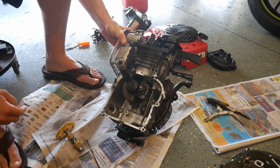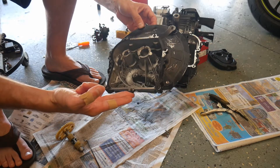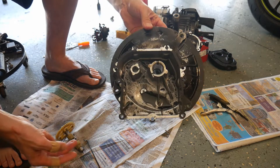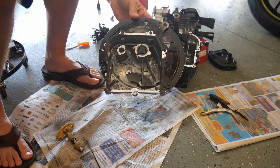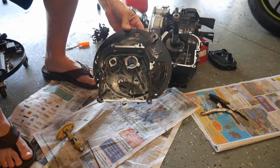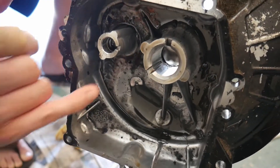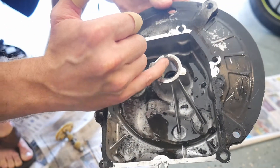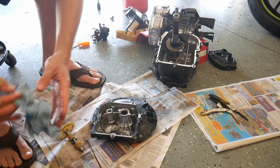Next day, we're still working on the engine. Now we're going to do a little bit of work to the other side of the case, because the most important thing with this conversion is to make sure the bushings for our camshaft and main shaft are all getting plenty of oil flow. There is a feed for this but it's on the wrong side — the bottom side. We want to create an oil feed on the top one here, so I'm just going to put a simple notch into that with a Dremel tool.